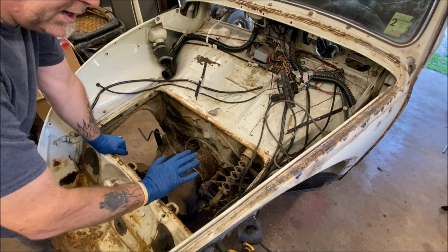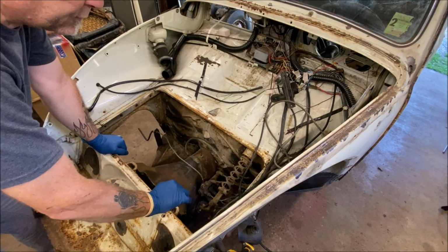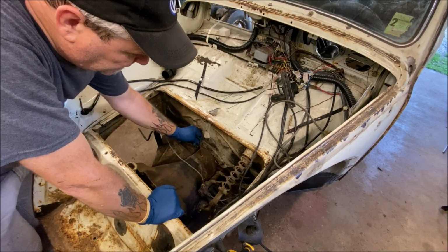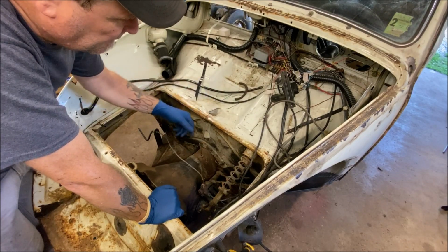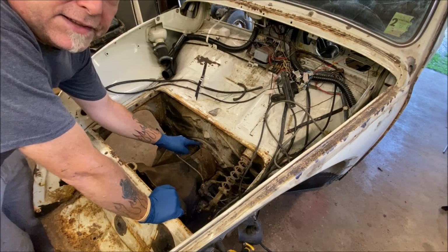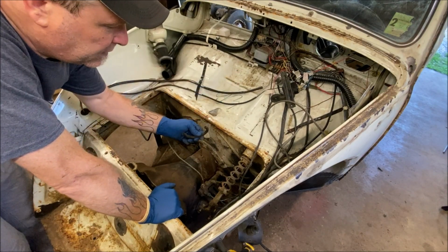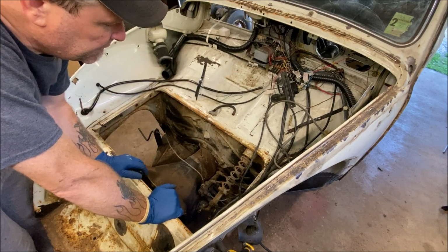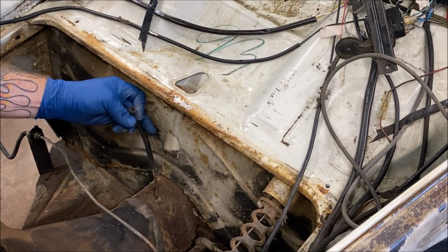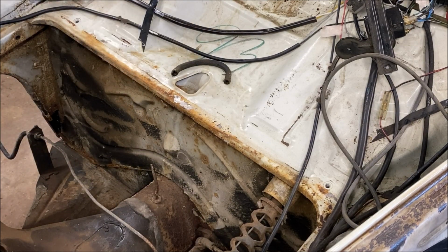First things first, we are at the front of the car, and this is where your gas tank is. Now, my gas tank is obviously removed, and here is the old poopy fuel line. There's a piece of hose on it that I'd left on there. I'm going to take that off. I don't need it on there. I'm going to be pumping brake clean out of a can in from the front and using my air nozzle, which, yeah, I will need that hose on there for the air nozzle. But anyhow, here, I'll pull you in closer. I'll actually end up putting that back on so the air nozzle can fit in the hose, because it's not going to fit in the metal line. So, okay, there's that part. Let's go to the back.